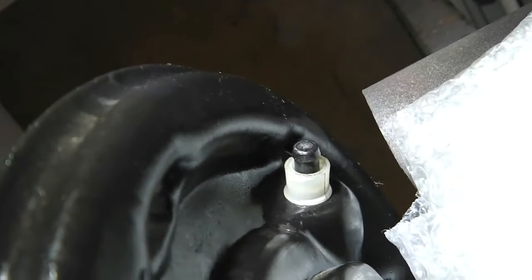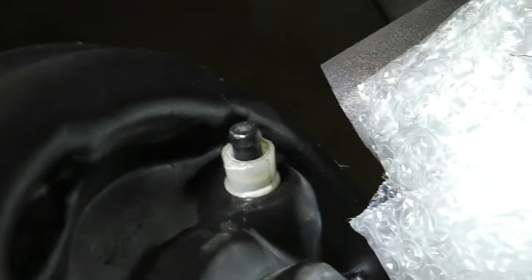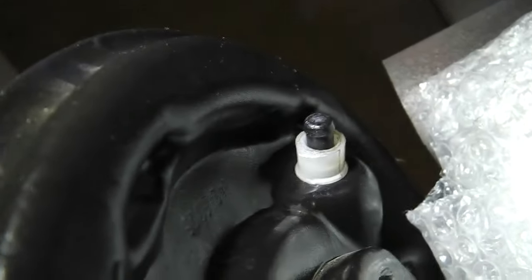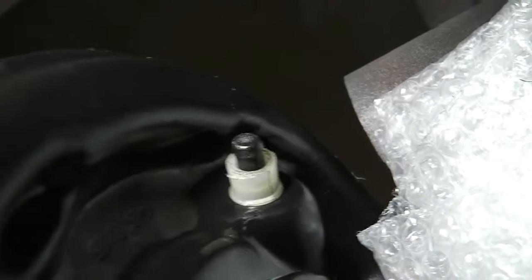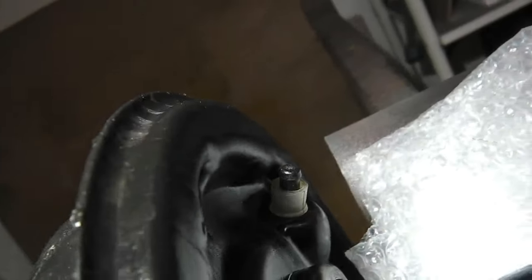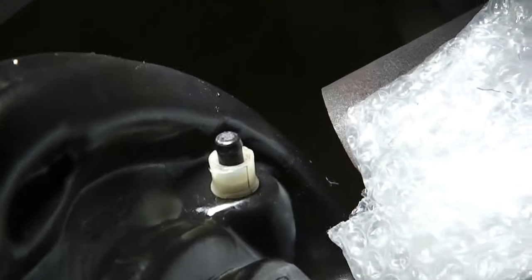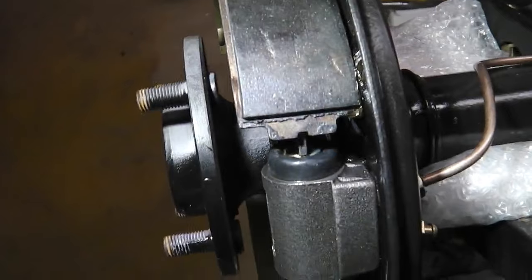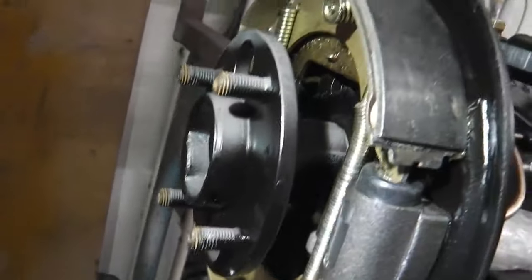It's a wear indicator. I don't think it's a way of adjusting the brakes or taking up that ratchet. It doesn't seem to operate the ratchet by the way it's designed. So I think that's a measurement device. I can't find any documentation on it just yet. It just calls it an adjustment plunger in the book. But we think that might be to measure the amount of movement. In fact, I seem to recall reading that in the Ford book about measuring that tolerance. So it's a little plastic plunger that moves up and down, and it touches on part of the brake mechanism inside on that lever there. Pushing it down, as I say, doesn't seem to do anything. So it could be a wear indicator device. So other than that, we're all done.